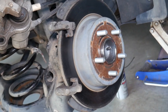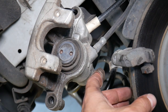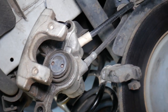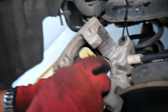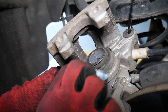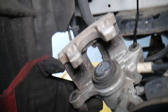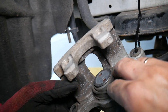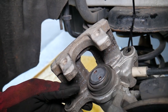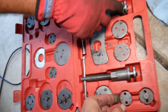Next, we need to explain how to compress the brake caliper piston, because otherwise you will not be able to install it — the new rotor and pads are thicker. It's recommended to clean the seal and the piston really well before compressing. Some people use brake cleaner, but make sure it's the type that is safe for seals; otherwise you can damage the seal.